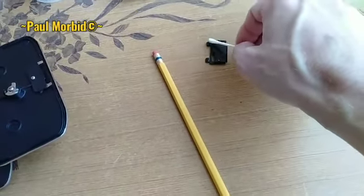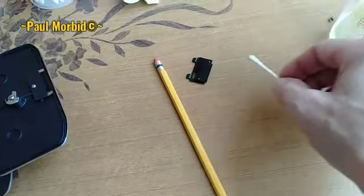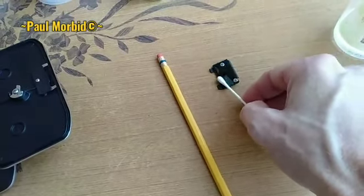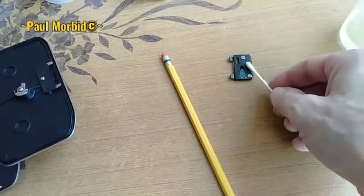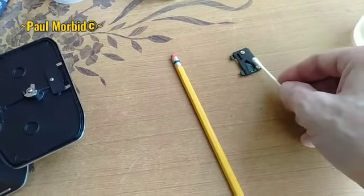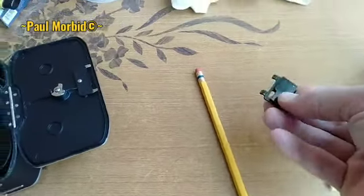Keep your Bolex clean. These are well-made cameras. For those of us who know, to beginners, make sure you clean them frequently. The film gate area collects a lot of dust and particles from the celluloid film. And in a country such as the Philippines, although it's a beautiful and amazing country, it's extremely dusty. Alright, take that part when you're done.